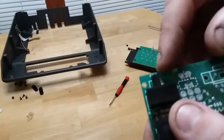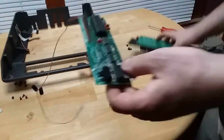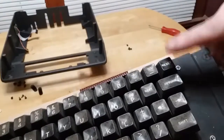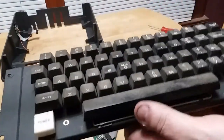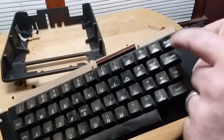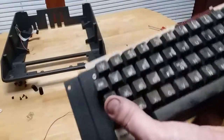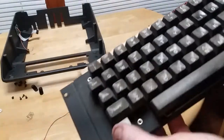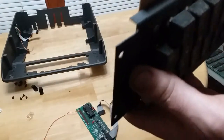And this switch here, control and reset, what that does is, if it's set to reset, if you hit the reset button, it'll reset the machine while it's in use. Which means that if you're typing a BASIC program out or typing anything, and you accidentally hit reset, you lose all your work. But if it's set to control, it has to be control reset at the same time, which is really good because that would reduce the risk of screwing up and losing your work,